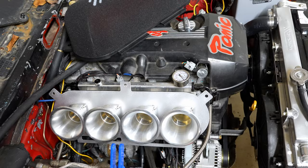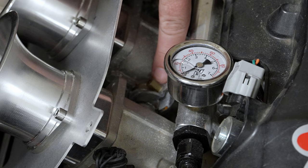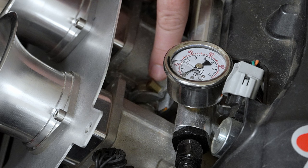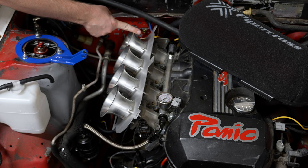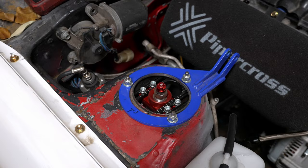This is PanicMate's filter backing plate, paired with a Piper Cross filter. For each throttle body there are adjusters to set the bottom set point — a lock nut and an adjusting bolt or screw in the middle. We've got adjusters one, two, and three. For this ITB setup, all the airflow will be referenced off the back throttle body, so we'll measure that one first and then adjust one, two, and three to match it.